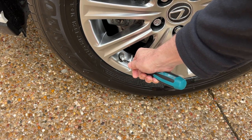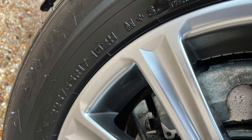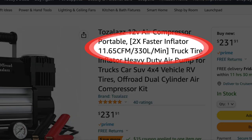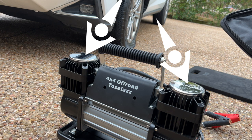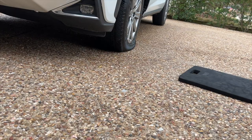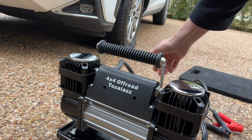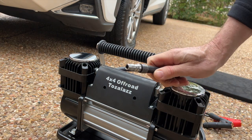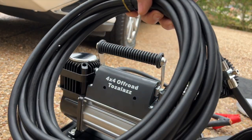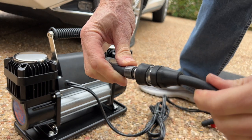I'm going to let the air out of my front tire on our Lexus NX — basically a 225 by 65 17-inch tire — and we'll see how fast it airs this up. Tozalaz claims that this will air up a tire twice as fast, and those twin 60-millimeter cylinders should be a big reason. Now that my tire is completely out of air, let's hook this thing up. It's a good thing they give you a sturdy handle, because this unit weighs almost 24 pounds. Here you can see the DC alligator clips that will hook onto the battery. This is the quick disconnect for the air hose. One word of caution: make sure you cut off these zip ties before you put this in your truck — you may end up out on the road and not have a knife to cut those off. That 25-foot air hose feels like it's very good quality, and I really do like the quick disconnect. I think that's a great feature.